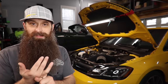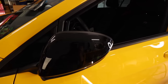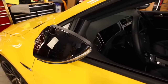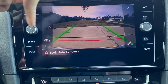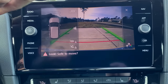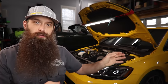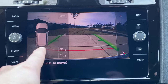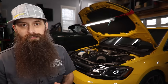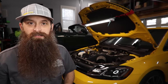There is almost an unlimited amount of things you can do with software adaptation and coding changes. Here are a couple I've done: turned the sound actor all the way down, coded the power fold mirrors — which are an add-on and an awesome one at that — added and then coded our touch handles for the rear doors. One of my favorite coding changes is when I put it in reverse, you used to have to hit the button for the little overlay of the car to pop up and show you where objects were around the car. With a simple coding change, it pops up automatically so I don't have to hit yet another button.